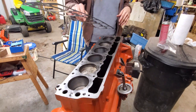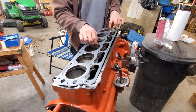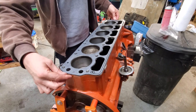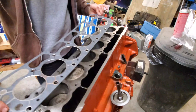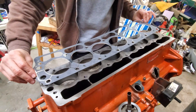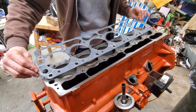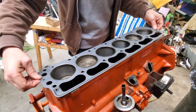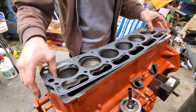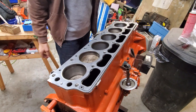Here's our head gasket. We've wiped our surface down with brake clean. It's dated 03-07-20, so it's been on the shelf for a couple of years. Lines up real nice to the dowels. It has some pretty nice fire rings on there. You want to make sure there's no major imperfections, which it doesn't look like it. It came from a factory, so you always make sure there's nothing that looks real weird. It's looking pretty good. So that's just going to wait there, and we're going to clean up our head.